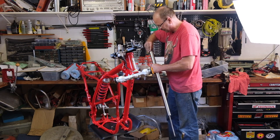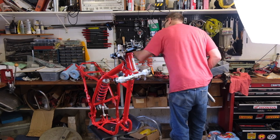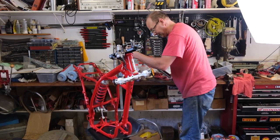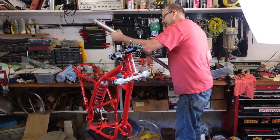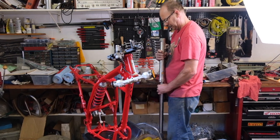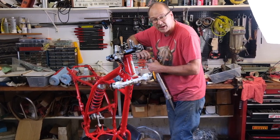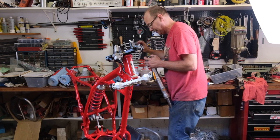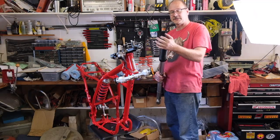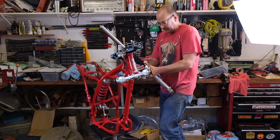Then there's a spacer, and then there's the cap. Just start it so you've got a little tension on it and it'll stay in place. Make sure it's clean first. You've got your aluminum piece on the end and then you can slide this in. Put the screw in the end. The best way I found to tighten these - you're supposed to tighten them with an Allen wrench but you're going to get so far and it's not going to tighten. So I'll just hit it with an impact wrench and they tighten right up. And then we've got the last existing boots that aren't cracked for an 83 XL600R.